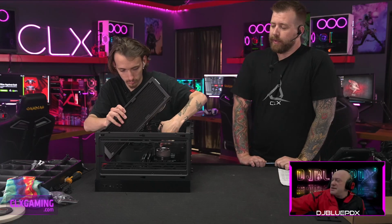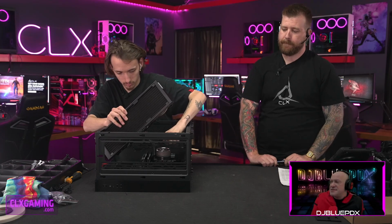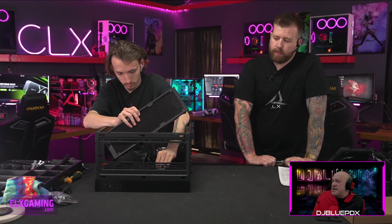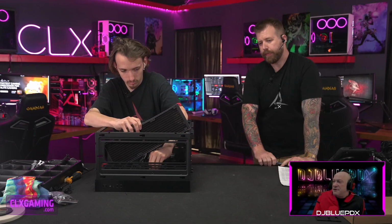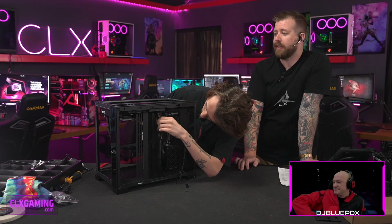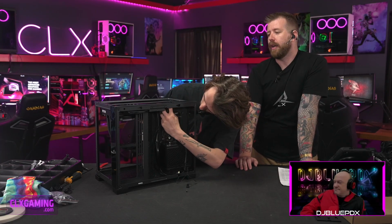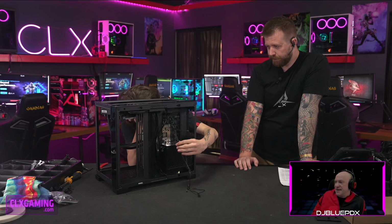Dundee Blur says, my current motherboard is a ROG Strix B450F with a Ryzen 7 2700X. I have found that Hogwarts Legacy doesn't run well with my 1070, and also probably the CPU, kind of sad. But I can play Halo Infinite fine. Different engines, I guess. Yeah, so I would say if you're wanting to get your frames up in Hogwarts, probably look at your video card. Unfortunately, that 1070 is getting a little old. It's pretty sad when the 10 series is aging, but it is. So that's where I would start there. I'd say your CPU is probably just fine for that game. Yeah, there you go. Awesome. Let's see. Next on the questions.